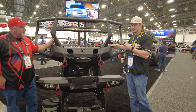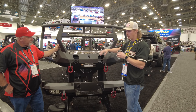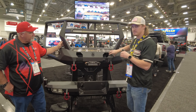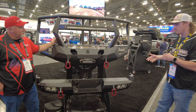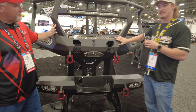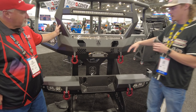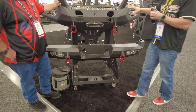This is our new series, our Evolution Series. It is built like our steel — seven gauge steel, fully welded. It has quarter inch brackets behind it. It keeps all your factory sensors and adaptive cruise control. As you see, this is a 617, so this is made for the 17 to 22 Super Duty. The big idea behind it is it accepts a center mounted light bar as well as a 12,000 pound winch, so you get both those options without having to sacrifice either of them.